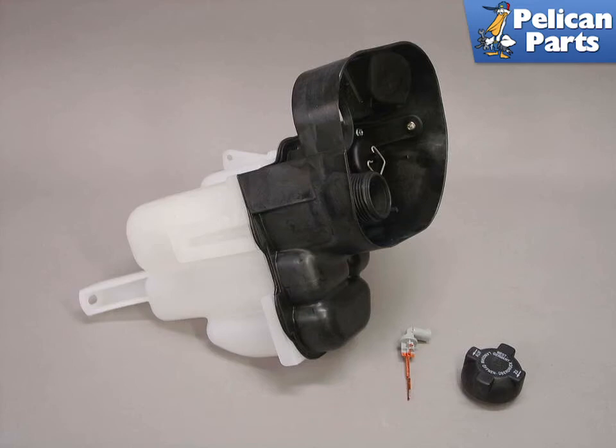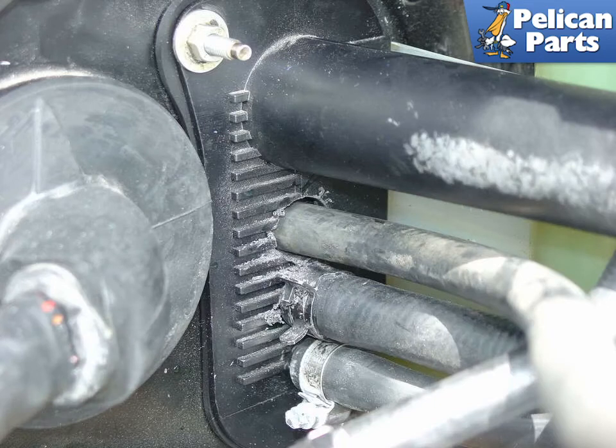Shown here is a new tank along with a brand new coolant level sender and the new expansion tank cap. The oil filler tube bulkhead manifold is one of the goofiest designs I've seen in a long time. In our project car, coolant just started spilling all over the place from a broken plastic nipple on this manifold. I fixed the design of the manifold and simply cut a hole in it and ran a hose directly from the engine compartment to the bottom of the tank. It was thought of as a temporary fix, but honestly it's been working great to this day.